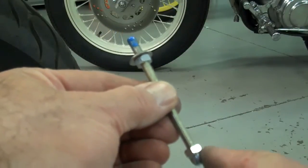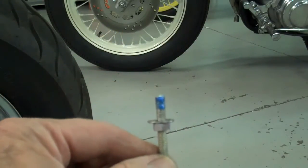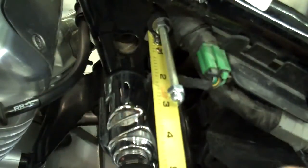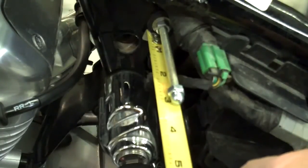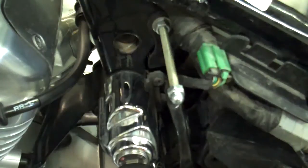Here's the acorn nut on the end, and here's the washer and lock nut. I've already put the blue Loctite on the threads. On this side you need to go in about 2 and 3 quarters inches from the plastic out to the base of the acorn nut — that's approximately 70 millimeters. Go ahead and do that, then tighten up the lock nut, and we're ready to mount this side cover.